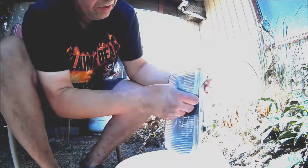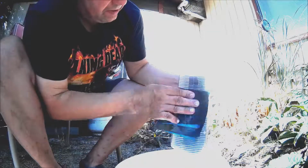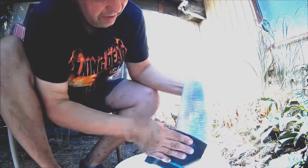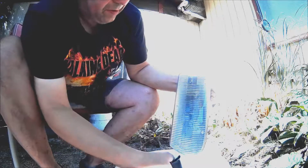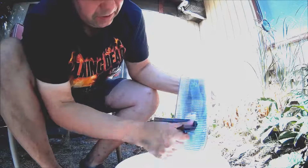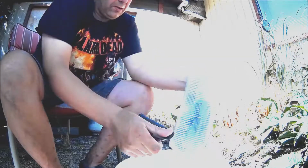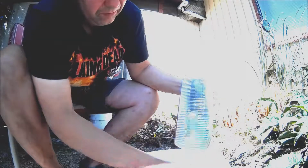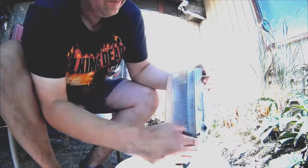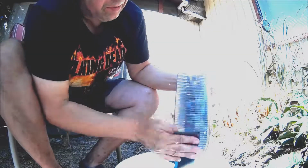I suspect that the issue with the polishing kits is this polycarbonate plastic. I don't think it likes UV very well. I think they put some kind of coating on it to begin with to stop the UV from damaging it. And when you polish it, I believe that you ruin that coating, whatever's left of it. The headlights are already milky when you're polishing them, or you wouldn't be polishing them, so damage has already started.